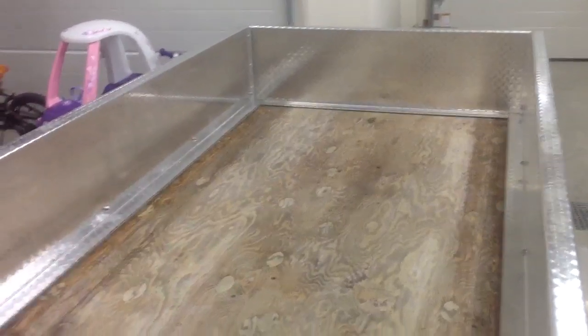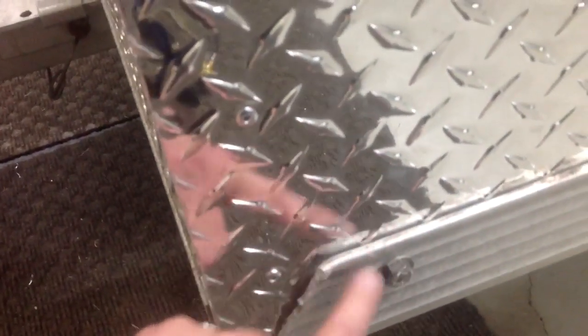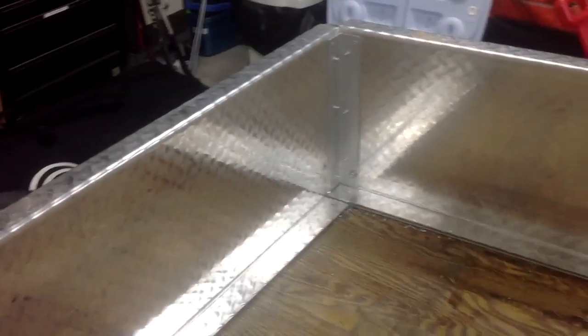It really makes a nice little box. The sides are 15 inches high. I used stainless steel bolts and nuts every 16 inches, drilled through the lip of the Triton and into the aluminum plate and bolted it down that way. Then to sturdy up the sides — I'm yanking on the trailer and these sides aren't moving — because I'm not a welder and I wouldn't attempt to weld aluminum, I used aluminum plating and aluminum rivets and riveted it in, and that ever made it nice and strong. I did it in that corner as well.